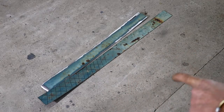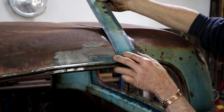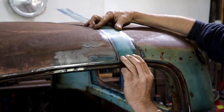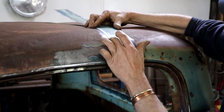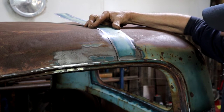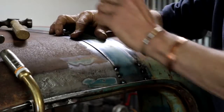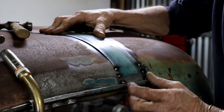I've still got these pieces that I cut out of the back of the cab when I chopped the roof. They're about roughly three inches wide. So if I stick them over here like so, to just lap the gap — got about a half inch overlap on each side — I'm just going to stitch them on with my much-loved stitches, and just provide a little bit of contrast to everything else and make it more interesting. Lot less work, and we are recycling. So I'm giving it a tack every inch and a half. I've made myself some marks so it's just nice and equally spaced, and then I'm going to work my way along starting from here.